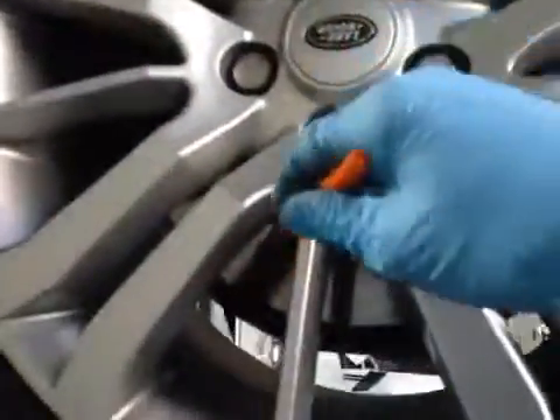Again, the front disc is lipped, and your front brake pads are on 10 millimetres — so the pads are in green, discs are in amber, and tires are in green on the health check.